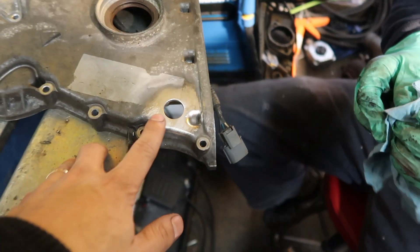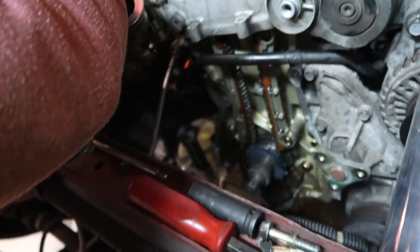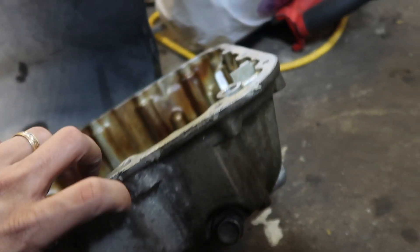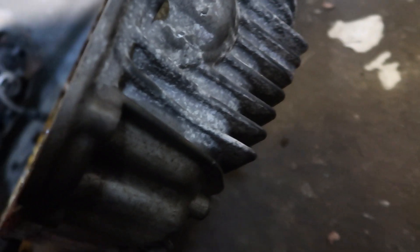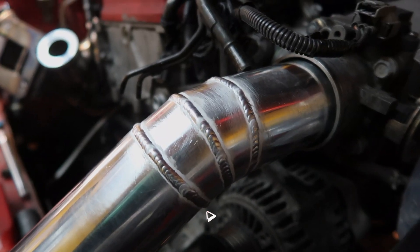This is where we're gonna put the drain plug - it's on the timing cover. We chose here because it's out of the way of the downpipe. The downpipe is gonna be going through the back down through there, so we don't want to put it on the side of the oil pan. On my uncle's car we put it in the pan, but we don't want to put it here because it's gonna be in the way of the downpipe. The best route was on the timing cover since it's a flush, even surface and it drops right back into the pan no matter what. And look at the dimes.